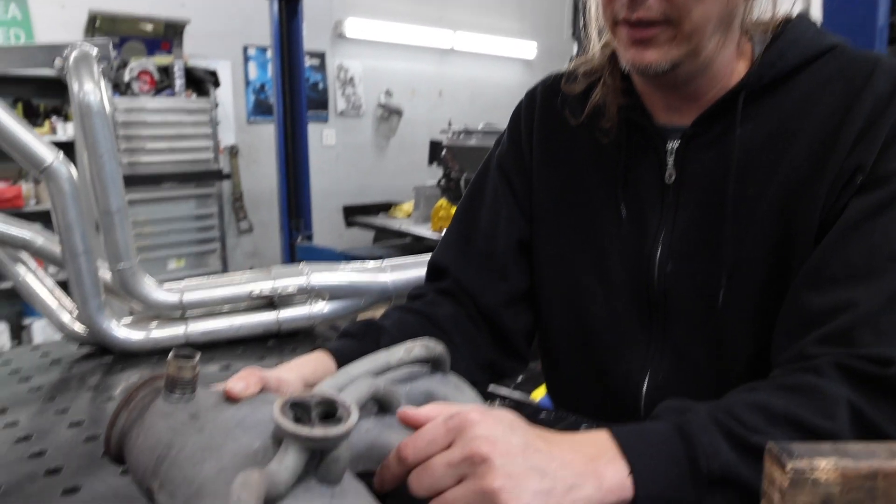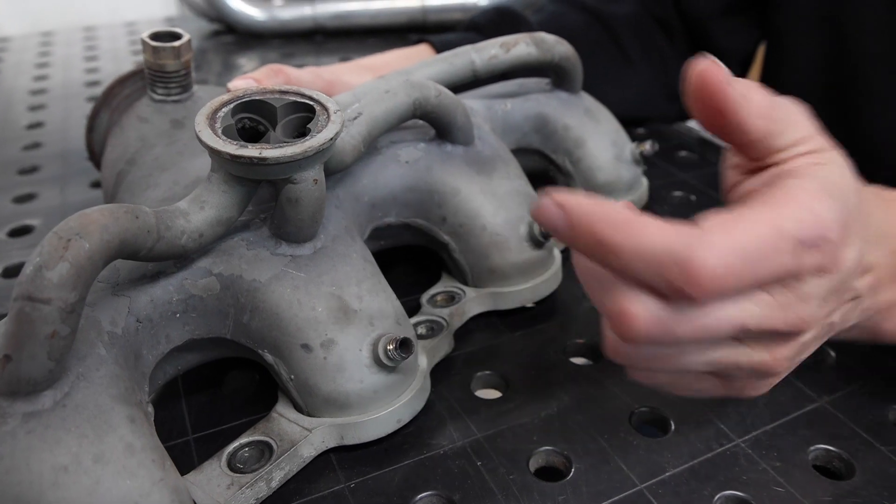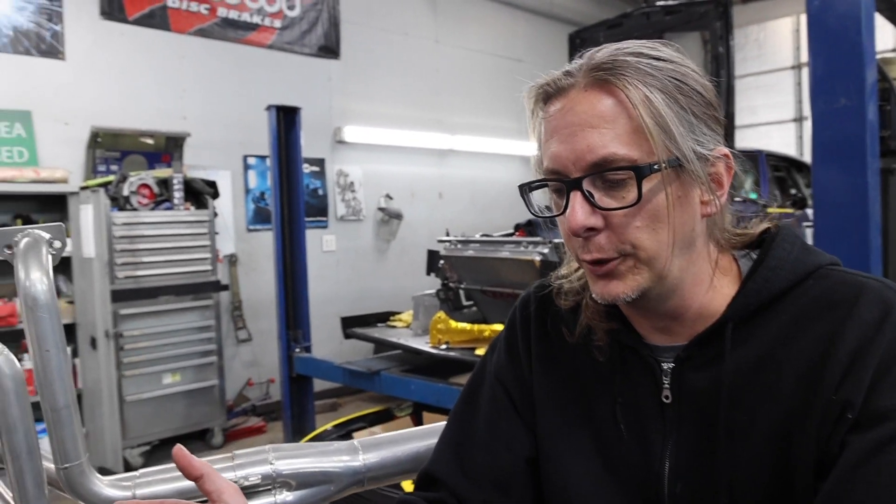So if you look in here, a lot of this is clearance to get to spark plugs, and easy access to the bolts, things like that. But the downside is the shape of the manifold isn't necessarily meant to be ideal for performance, and the length of the runners on one like this aren't necessarily tuned for the performance that we're going for. So we can also get some weird stuff with the cross-sectional volume of each of the individual runners going into the collector.